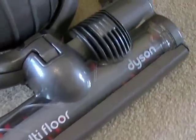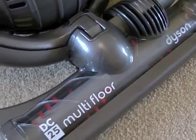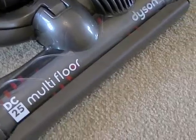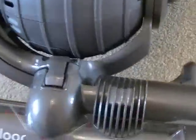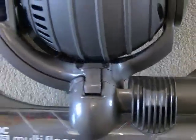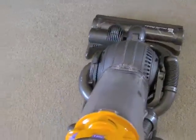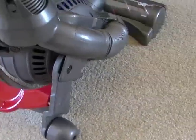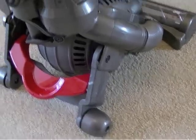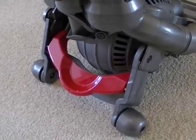Starting with the bottom, we've got the motorised brush roll with its own independently controlled separate motor. This means you can have the brush roll stationary when cleaning hard floors. It actually pivots and swivels. To get it into the operating position, we've got a large red foot-operated pedal. You just press that with your foot and recline. Now the machine is resting on the ball. The other two wheels at the back are just for stability, and when you put the machine in the upright position these wheels engage and keep the machine secure - especially useful when you're using the hose and in storage.